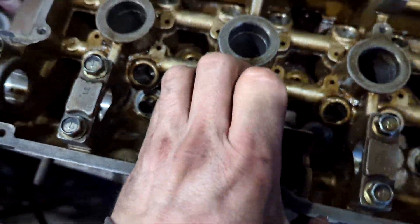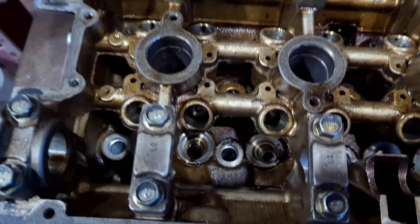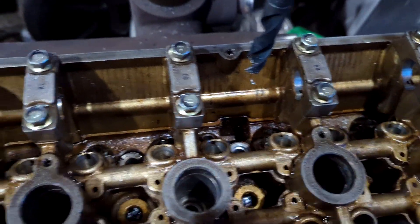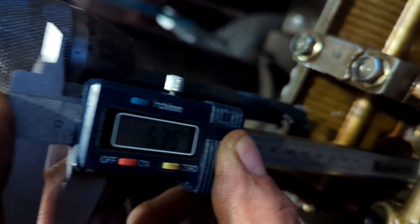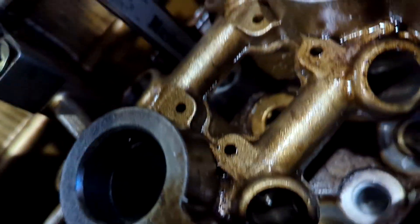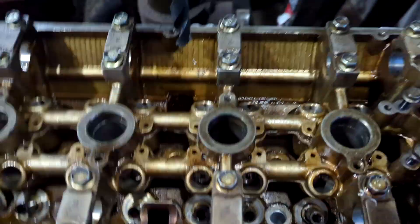Just to check, try the insert — give it a little blast of air. Don't worry about the chips; this thing is being hot-tanked and everything before I put it in service. I checked the depth with my calipers and we're about 0.35 over five millimeters, but a drill bit cuts kind of a radius at the bottom anyway so it's not completely flat — that doesn't really matter for the inserts.